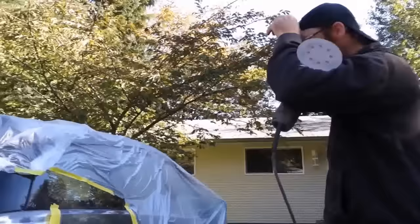So this is not the highest quality filler, right? No, this is not the highest quality of filler. A higher quality of filler will have a little bit more flow. Okay. But your cost of the filler is about $60 a can to $20. Right. Okay. And so it does the same thing. It's the same thing, but it doesn't flow, so you have a little bit more pinholes and such. Okay, but you work that out with the primer then at the end. Work that out with the putty and then the primer. Okay.